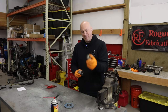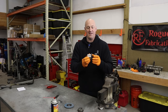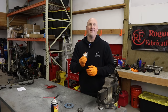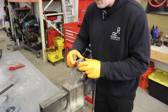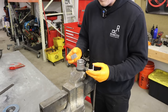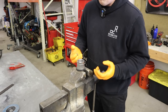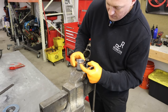So I ended up chopping it up and adding an extension to this timing gear for the pre-2009 Hemi engine — I'm just going to weld this thing on. We have to make sure it's fully squared up so the splines go in correctly. To line these things up as concentrically as possible, I'm going to take two pieces of angle iron, wrap them around either side, run a hose clamp around the whole thing and tighten it as much as possible — that should center it so I can weld the corners along where the splines are.